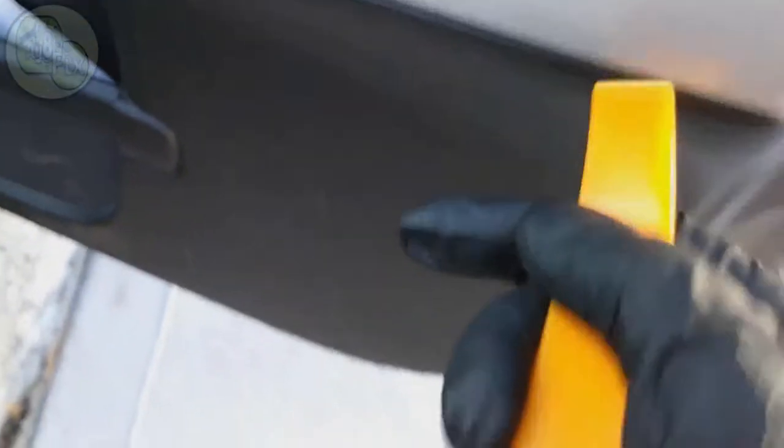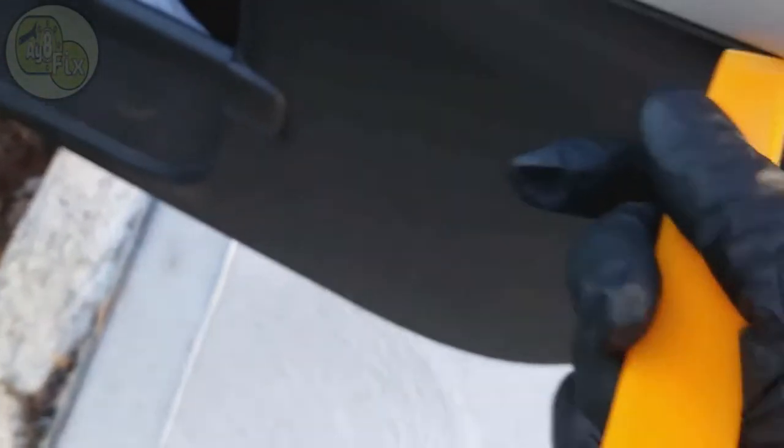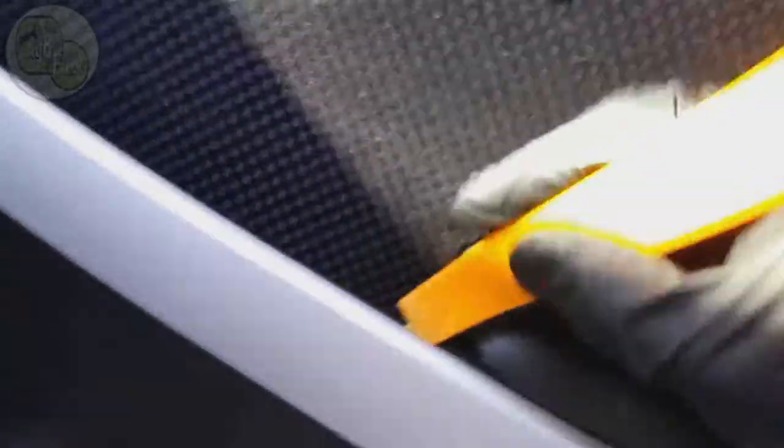You simply want to get in behind these — there are clips under these trim pieces. The easiest thing to do is try to get under there, but sometimes these things can be kind of tricky, so you want to take your time. Once you've managed to get some of the clips loose, just slowly drag your way down the bezel piece until you hit the next clip, then pull and pop them. They'll come off pretty easily with a tool like this, and since these tools are plastic they won't score up anything. Now I've gotten the bezel off.